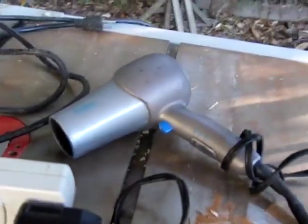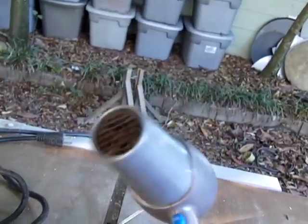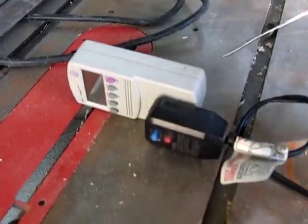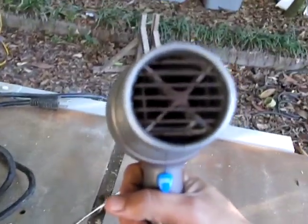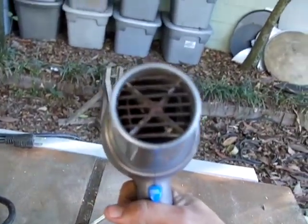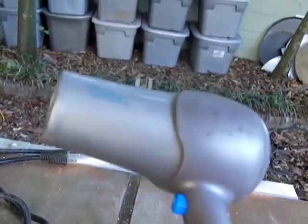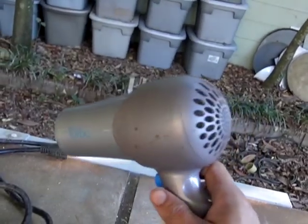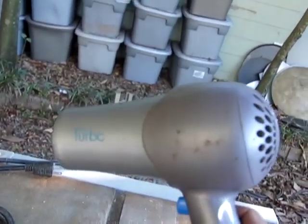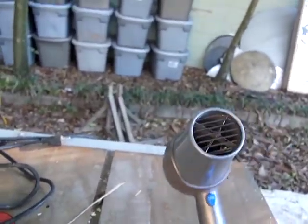If you're looking for a cheap or free version that uses the very same motor, this is a standard hair dryer. Hair dryers are alternating current — they use 120 volts, what your house uses — but most hair dryers have a standard DC motor inside. Older hair dryers use the element to convert the AC to a lower voltage DC. This one uses blocking diodes to create a bridge rectifier inside, which converts the AC current into usable DC current. This particular hair dryer probably had several hundred hours of use on it and it still works perfectly.